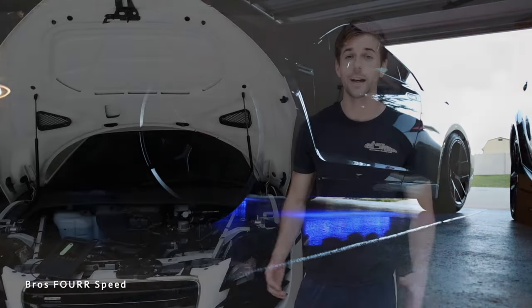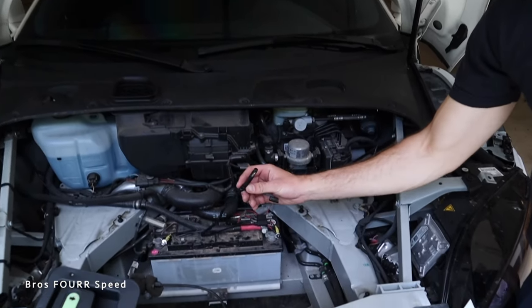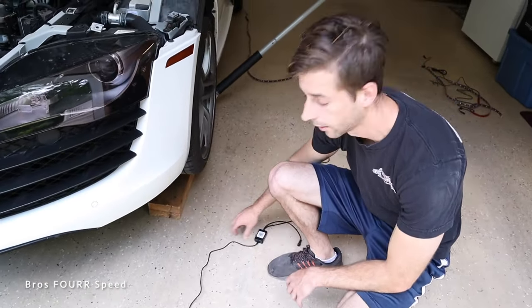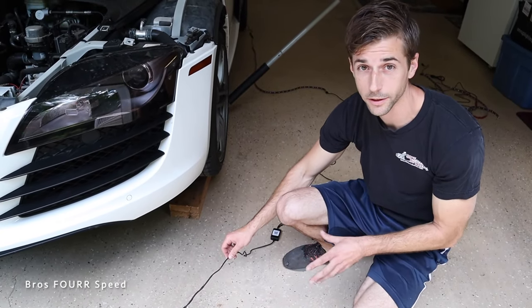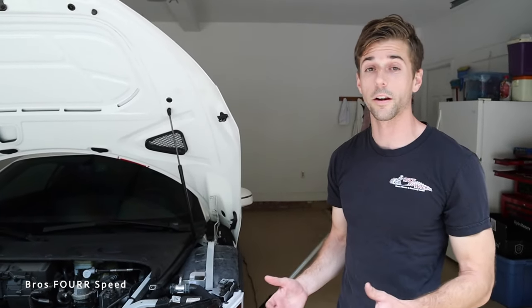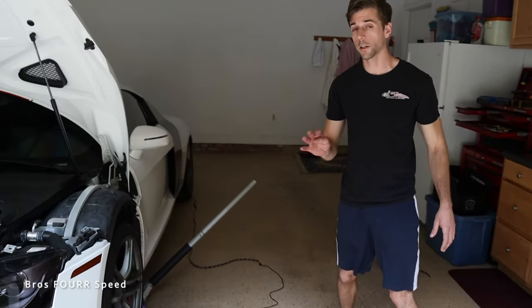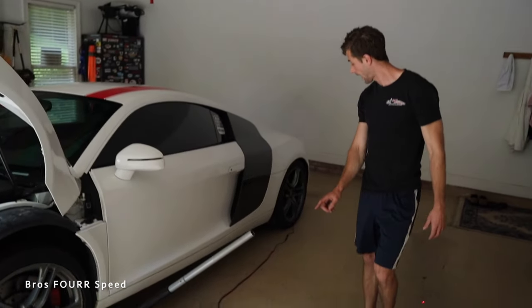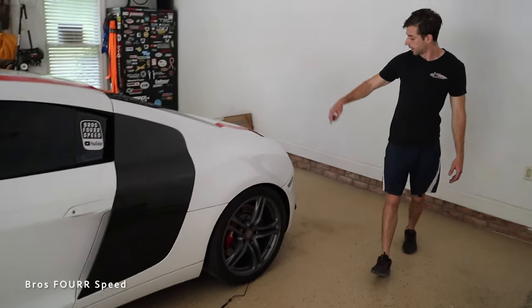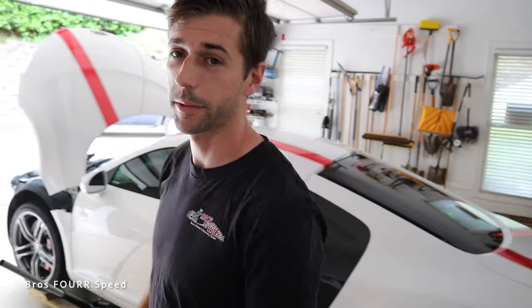New day — on to the Audi R8, using the same battery-tender connection as the GTR. Just to note: the kit is a direct plug-and-play system — positive to positive, negative to negative straight to the battery, though a plug adapter may flip polarity on the LEDs. For the R8 I'm running four strips in a big loop: one long strip on each side, a short one in the front, and a short one in the rear, with a single wire running up into the battery area.